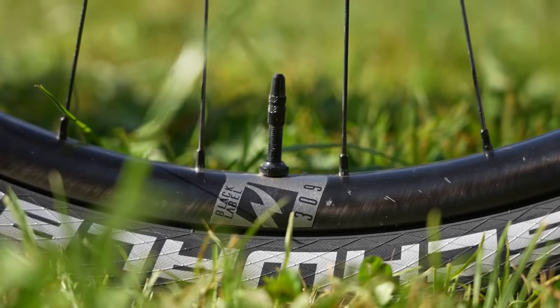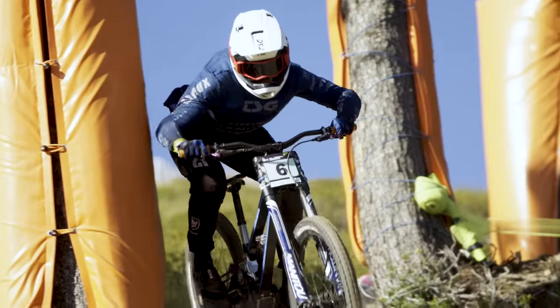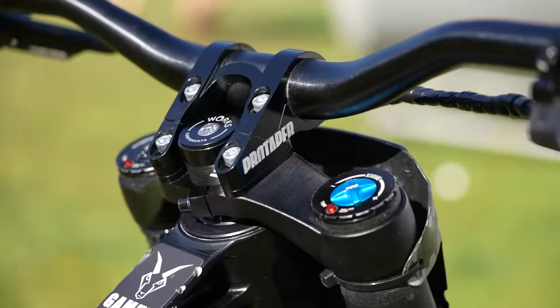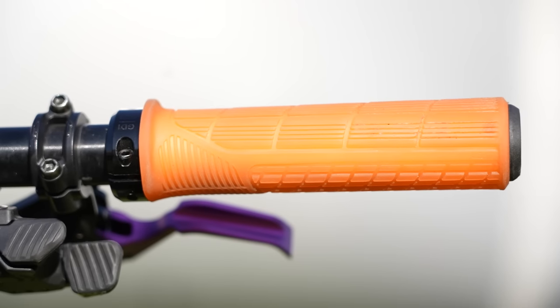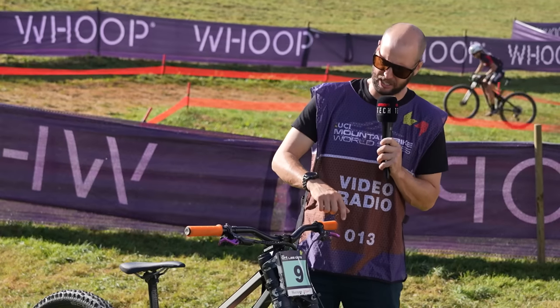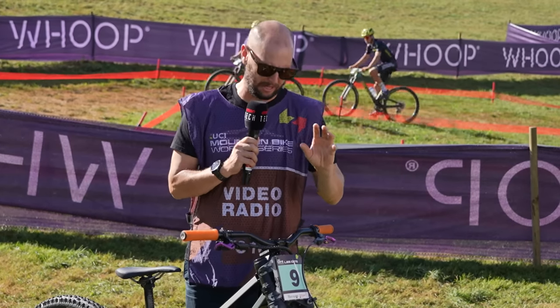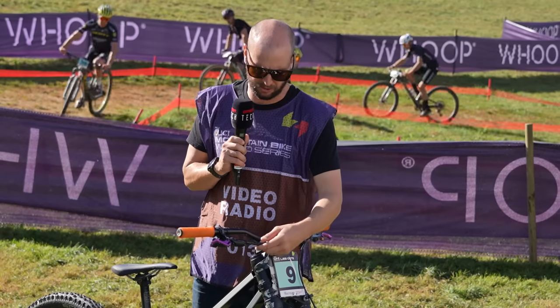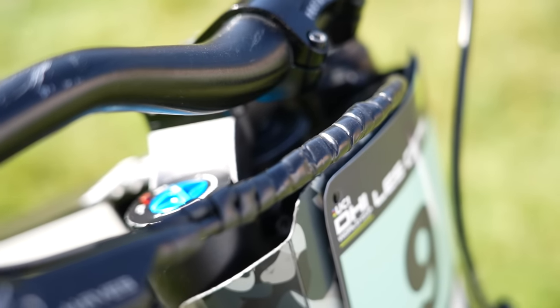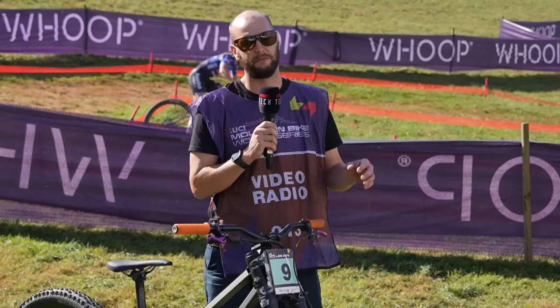That's married up to a 200mm rotor up front. We've got a Reynolds 309 Black Label Carbon rim and the super tacky ultra-soft compound Schwalbe Magic Marys. Moving up to the cockpit, it's an Answer Pro Taper affair with a direct mount stem and bars, Ergon GD1 grips at either end, and some purple haze Dominion brakes in that lovely little purple color. I've noticed the levers are wound quite far in — they're really close to the bar. Downhillers love quiet bikes, so we've got taping to keep all the hoses together, plus a neat little custom guide at the top of the forks to stop that front hose from rattling around.